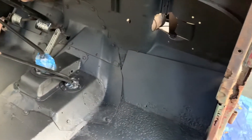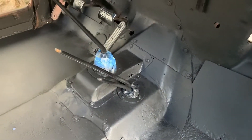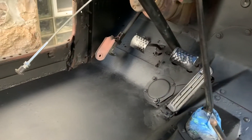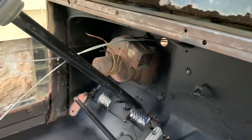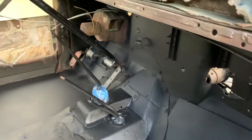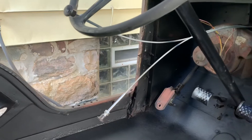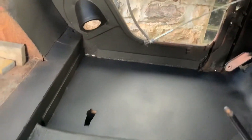I've been spending some time inside working on this and getting it cleaned up. Right now it's drying — I sprayed some spray bed liner in here. I went through and rebuilt this console area. I went ahead and put in the accelerator pedal, and the brake and clutch are in. Once this is all dry I'm going to put in the dash, which Ken gave me as a spare and I've stripped and painted. Then I can put in these two cables — the choke and the throttle — as well as the handle for the emergency brake down at the bottom. Once those are in and the gas tank is in, this thing's ready to go. The gas tank goes right there under the seat.